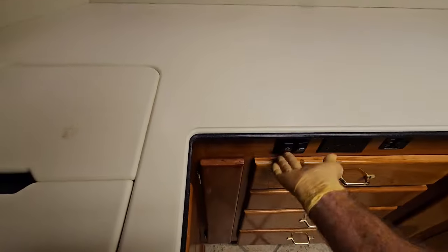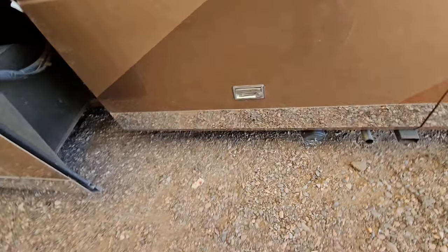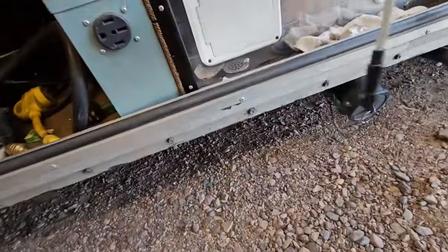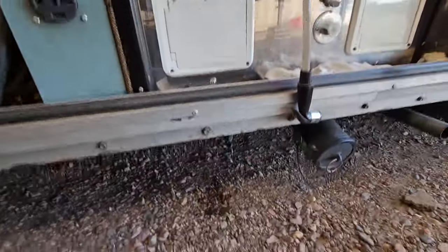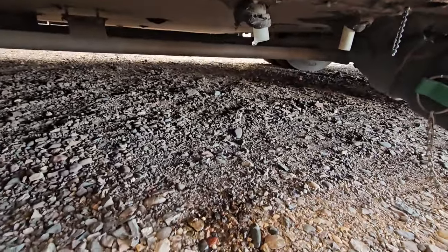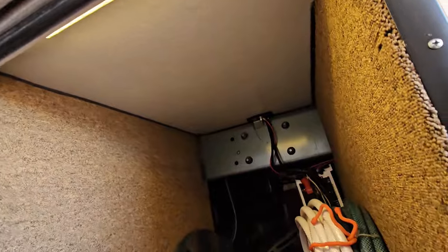Okay, so obviously the first thing we have to do is turn the water pump off. We'll do that there. I'm going to go ahead and release the pressure right there. I'm going to go ahead and just release the pressure right there too. I'll do my other drain there. All right, so hopefully the pipe should be pretty low on water now.